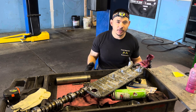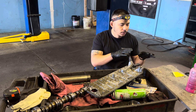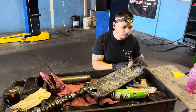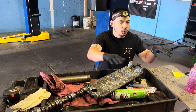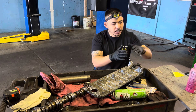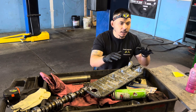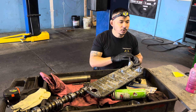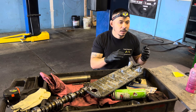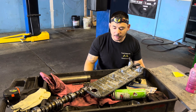One last note: the head gasket kit we ordered came from eBay and everything looked good, but the head gasket itself was a little bit different. Where it labeled the front of the engine, there was a coolant passageway that was actually blocked off by the gasket. Make sure the gasket and all the holes line up exactly the same. Before you take the gasket off, take a picture and note all the passageways it's either blocking or not blocking. When you put the new gasket on, make sure it matches that picture exactly — in our case we actually had to flip it over even though it said 'front.'